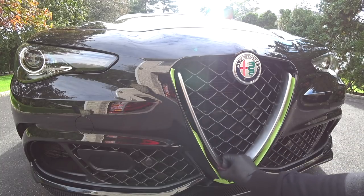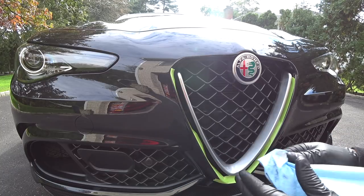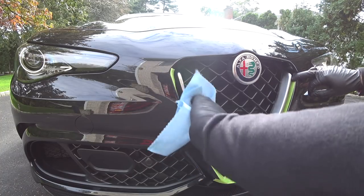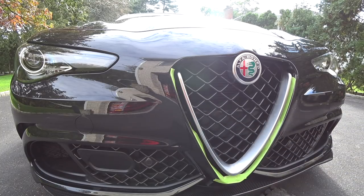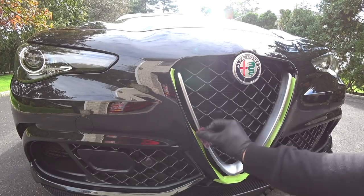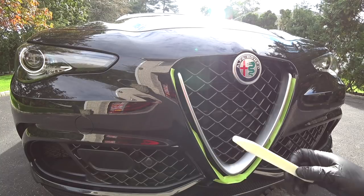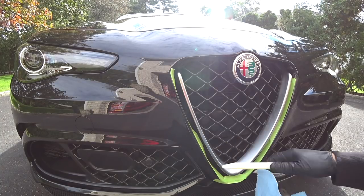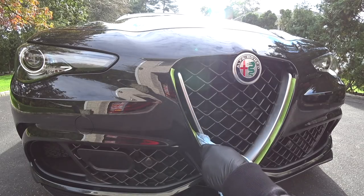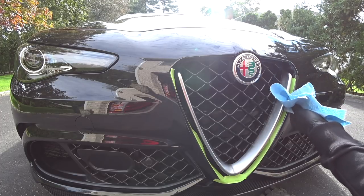This factory piece has an aluminum coating on it. I took the scuff pad to give it a brushed finish — you can see the material coming off. We really want to pay attention to this edge because that's where most of the bond is going to happen, and it's the most critical area for keeping water from getting under the surface. For tight recesses, I use my nylon wedge tools — I'll be selling these in my web store soon. They let you get all the way around and clean surfaces you can't reach with your finger.